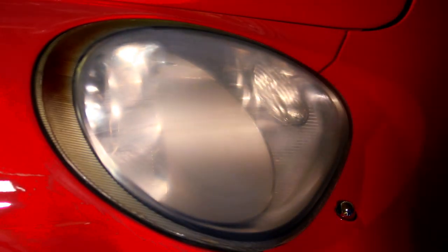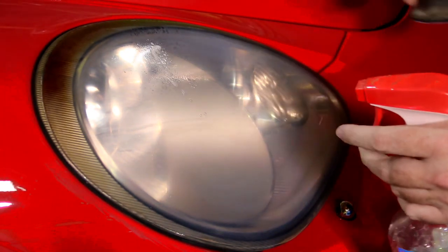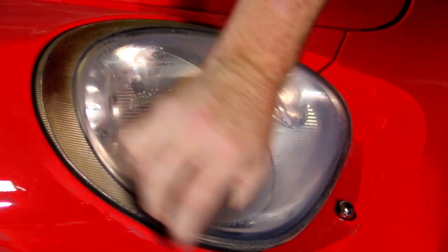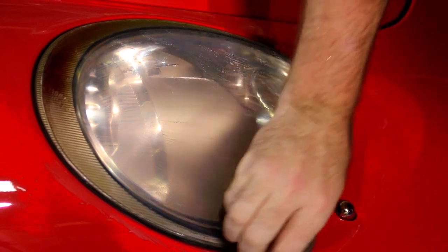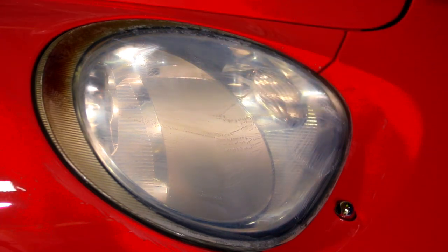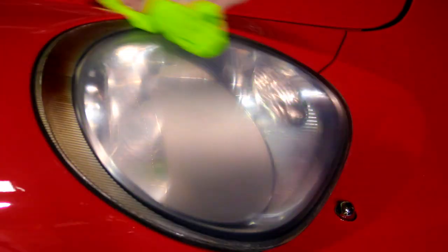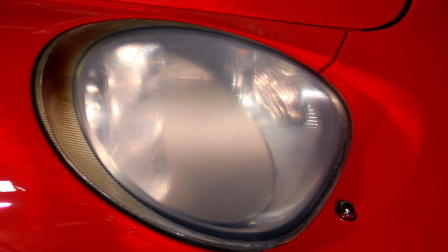You can see it haze up a little bit in the camera — probably don't need to go too far with it, we'll do it one more time. First thing I'm going to do is rip that tag off the microfiber because we don't want to scratch our precious car. This thing's dirty anyway. I'm going to put her 1000 down and grab the 3000.